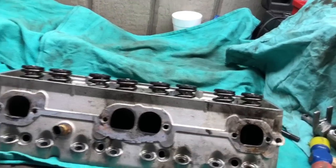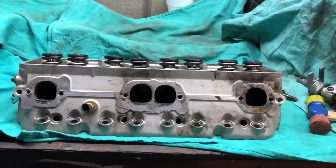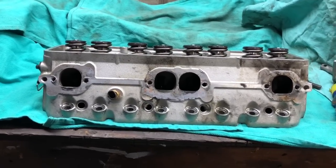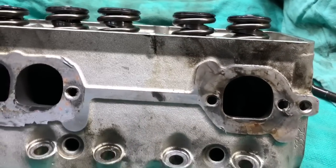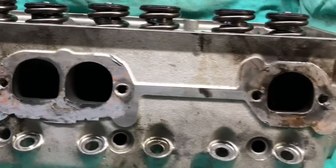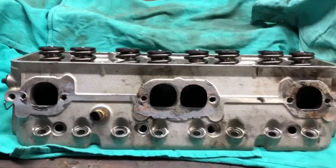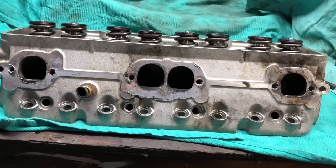We're over here working on the race car, gonna play with the head. This is the head — the other head is perfect, so nothing is wrong with the head that came off the driver's side. Only the passenger side head had an issue. I tried something new — I heard a little bit of a header leak, looks like almost all of them were leaking, and this one was leaking pretty severe. I tried a high temp gray silicone instead of the copper silicone, but that stuff did not hold at all. I might have to revert back to the copper or red silicone, or possibly put my copper gaskets back on. But that's not what we're here to talk about today — we're here to talk about the heads and how damaged they are.